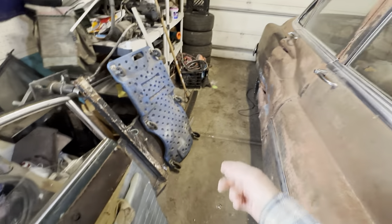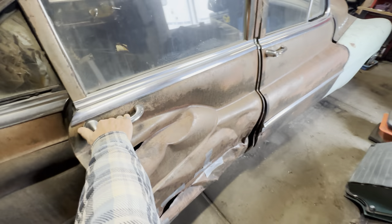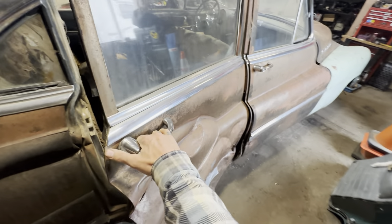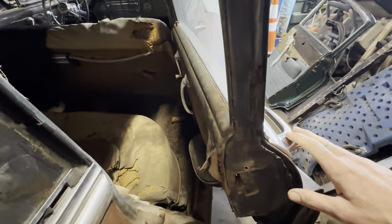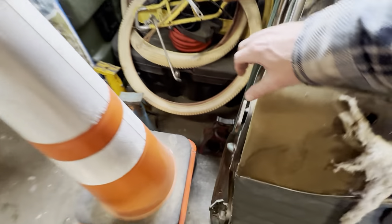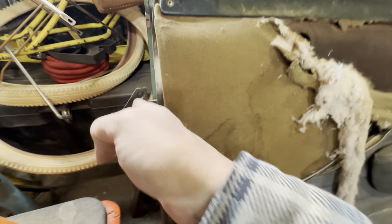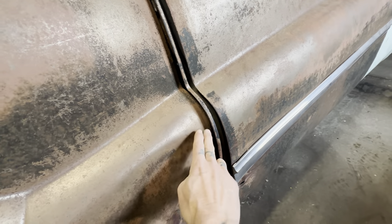Since the good window is on the damaged door, I'm going to have to gut it. I'm also going to have to cut all of that trim out probably. That's as far as I can open the door right now. If you know anything about these old cars, here's the hinge — I've got to get straight at it, which means the door has to be out 90 degrees just to access the hinges.